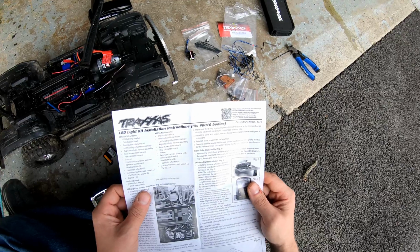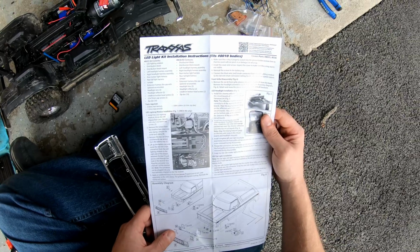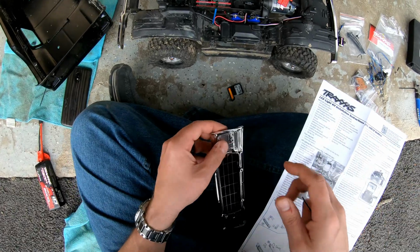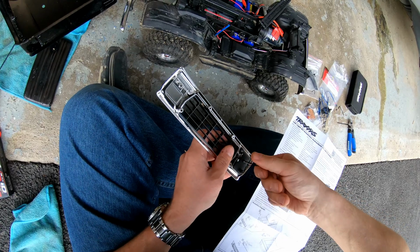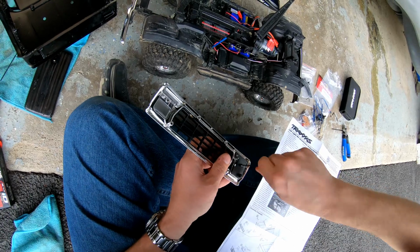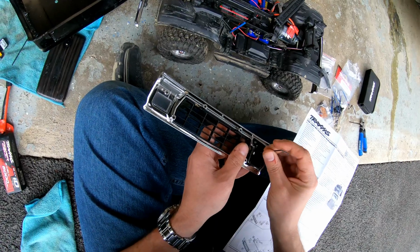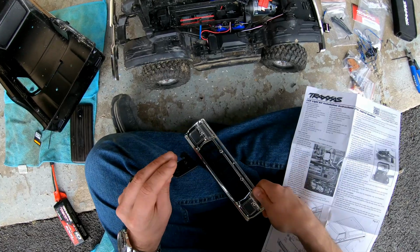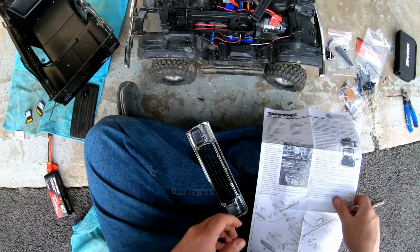Okay. Remove the headlight assemblies from the grill. See figure 6. Retain and reuse the plastic headlight mounts and hardware. I will say though, this is a pretty well thought out design. You can tell they were thinking ahead and anticipating the release of this kit, because it looks like it's pretty modular. So that's cool. Once again, save the screw and reuse the hardware like the instructions say.